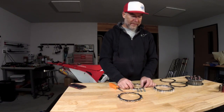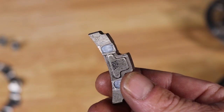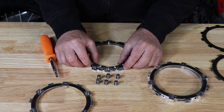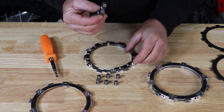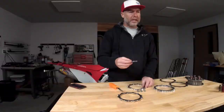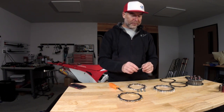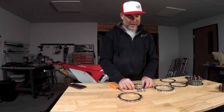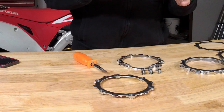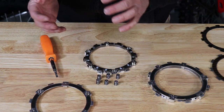The other thing you can change is the wedges. By going to a heavier or lighter wedge — they're available in different weights depending on the model, marked with numbers and letters — you can adjust feel significantly. A lighter wedge gives a softer engagement; in my experience it doesn't feel like it bites as hard and it releases a lot quicker. When RPMs come down on the lighter ones, the clutch releases faster — almost like snapping your finger quickly. Going to heavier wedges gives what I can only describe as a more 'bitey' feel when they engage, and it seems like the engagement stays on longer and comes off more slowly.